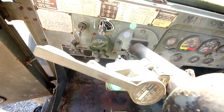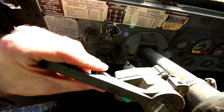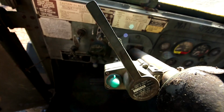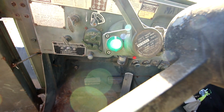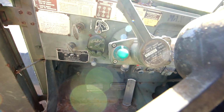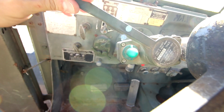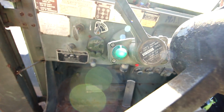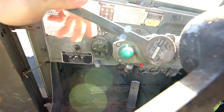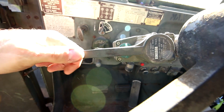And now if you want to turn on the four-way flashers, say you're going really slow on an interstate or a highway or whatever, you can pull this little plunger right here. You pull that up and it goes one more step over, and there you have your four-way flashers. All four lights are blinking at that point, and that locks it up there. Now you want to go back down, it locks it out. So you have to pull out to go all the way up to your final four flasher position. Then you have right turn, left turn, and no turn.